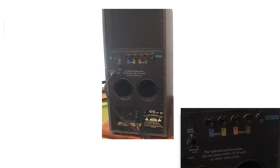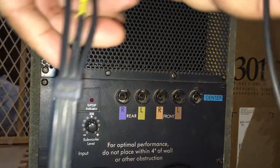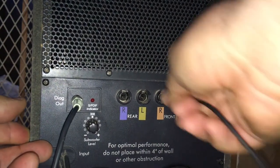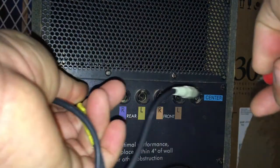On the back it has a diagnostic port to check its operation. The way it works is to simply turn the device on and connect each of the three inputs to the diagnostic port as seen in the video. I disconnected the speakers and connected them one by one to check that each individual channel is working properly — listen for a high-pitched sound if the channel is working.